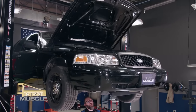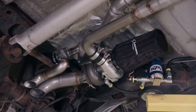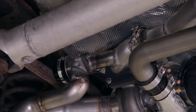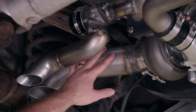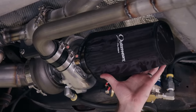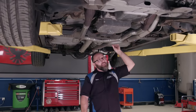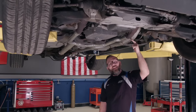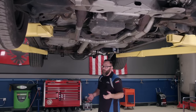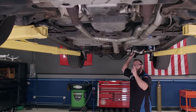We are making some serious progress on our 08 Crown Vic Police Interceptor. We are doing a generic single turbo system mounted out back where the driver's side muffler used to be — it's going to be tons of fun. LT came in from Truck Tech and welded up the hot side of our exhaust system going into the turbo. Coming out of the turbo he's got this nice downpipe and the wastegate looks really nice. Then we focused on the cold side — we've got this air filter here. We probably won't be able to drive this thing in the rain, but that's okay. We also did the charge pipe, going from two, two-and-a-quarter, up to two-and-a-half inches, sliding right up next to the exhaust and into the engine bay. We haven't connected it to the throttle body yet, but that'll be in just a little bit. The main item left is to get that fuel pump out of there because we need to upgrade that — more fuel to match more air going to that engine.